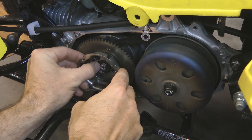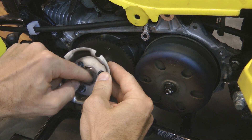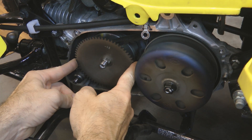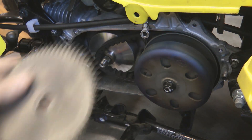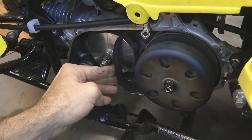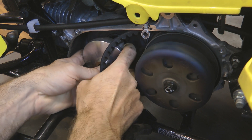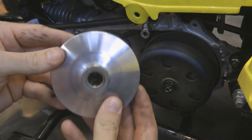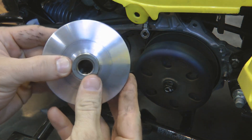With the nut off, pull the outer piece off — there's a washer in there so just be aware of that. Set it aside and then pull off the big gear, which I think engages the starter. With that large gear out of the way, slip the belt off the front and push it down out of the way. We're going to pull the whole front clutch assembly out as one unit — there are a few pieces in it. Here's the back piece; take this over to the bench.